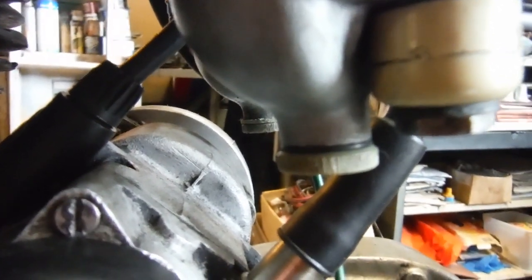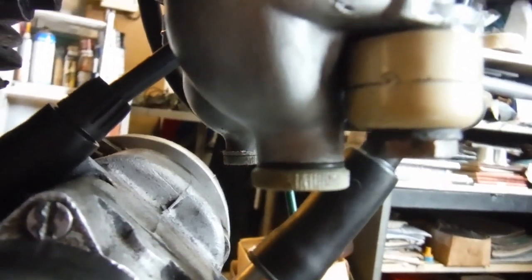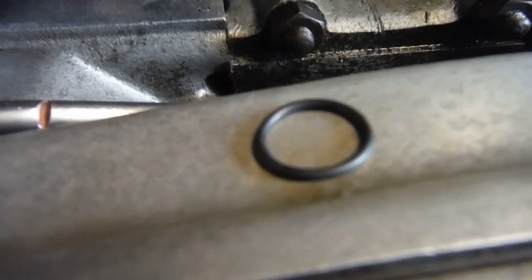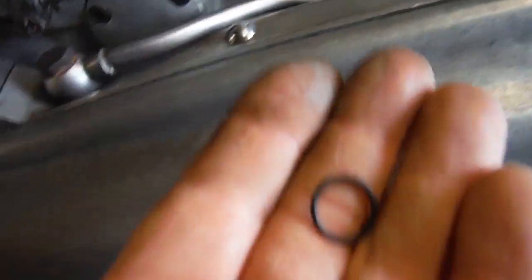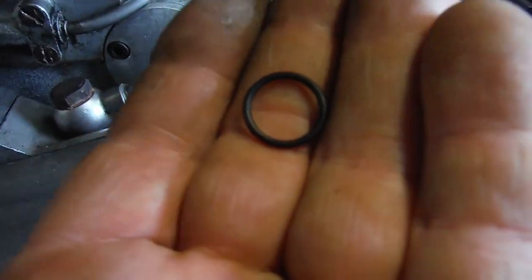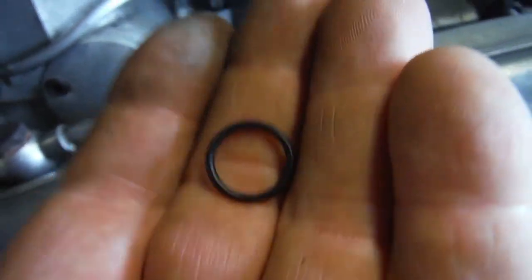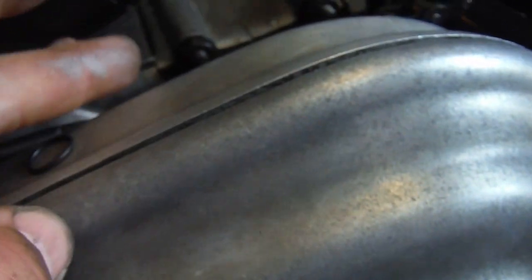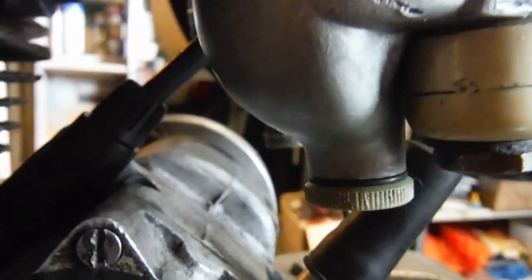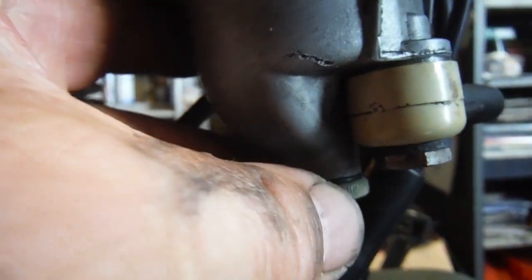What I've done from time to time, and I've just done it here, is fitted a rubber O-ring to the threaded plug — there's an example of one there. This one, out of my box of O-rings, is referred to as an R-06 size. It's a nice fit on the drain plug on the float bowl.